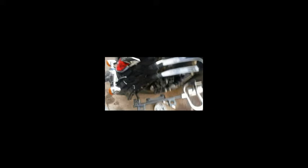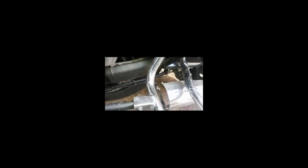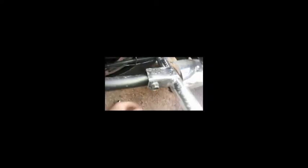Okay, got the first muffler exhaust off from the right side. Obviously the two bolts there. There is a shield clamp that goes in this area. I'll point it out, and then there was a hidden exhaust clamp. Okay, so the two 10mm bolts here. The shield clamp here, which I believe was a 15/16, and then down here, 10mm exhaust clamp. So I'll see you when I'm on to the next piece.